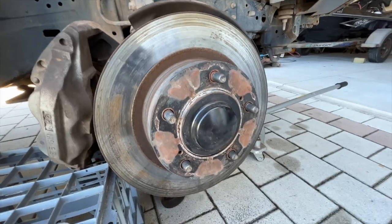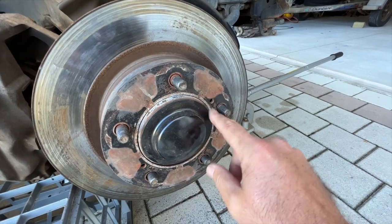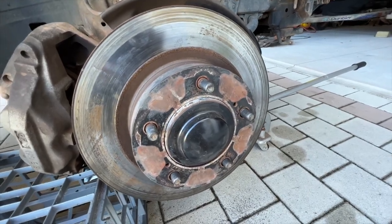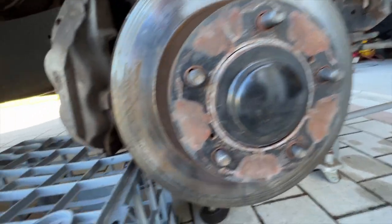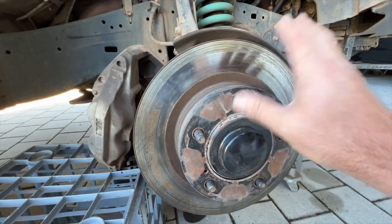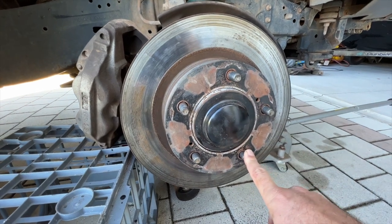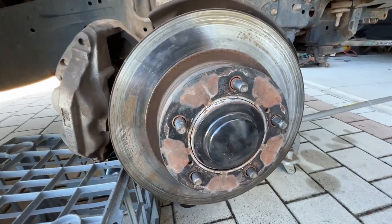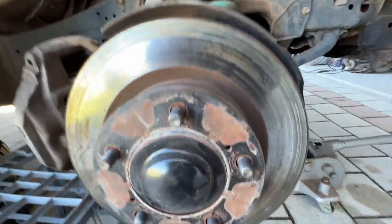I had to use the hammer to get this to come off because, looking it up online, these are M8 by 1.25 threaded holes and I tried every single nut and bolt in my spare collection and couldn't get anything to go in there. The rears are going to be a problem — I might have to go into town because the rears with drums and shoes inside are going to be way more difficult. But I just smacked the hell out of it and that got it loose.